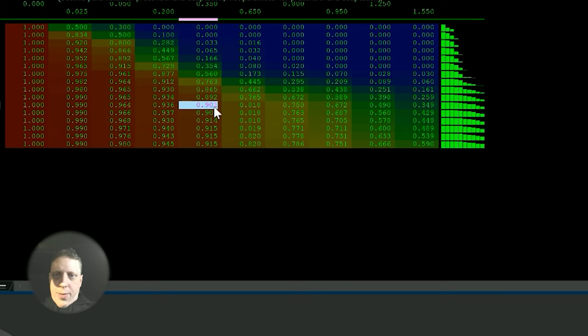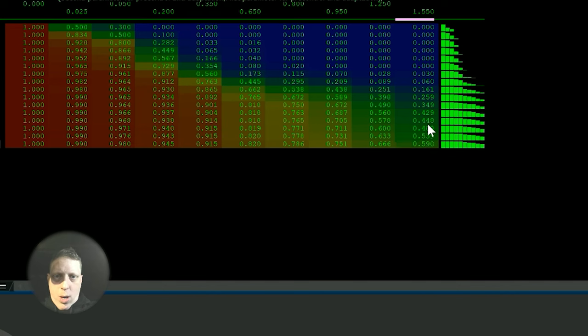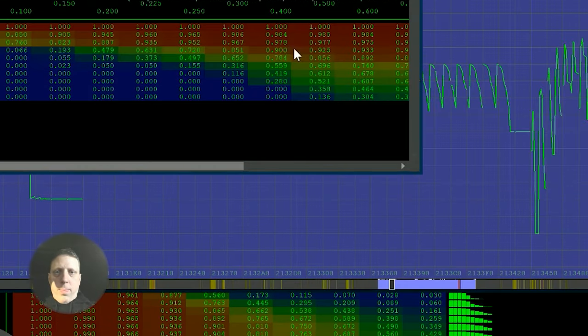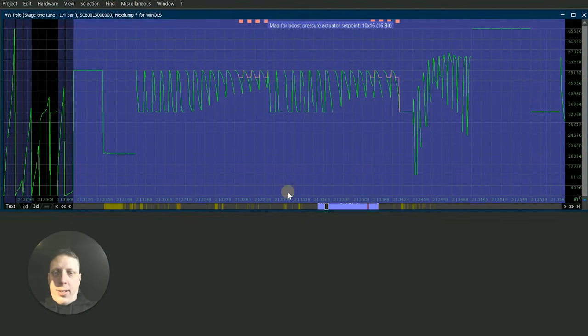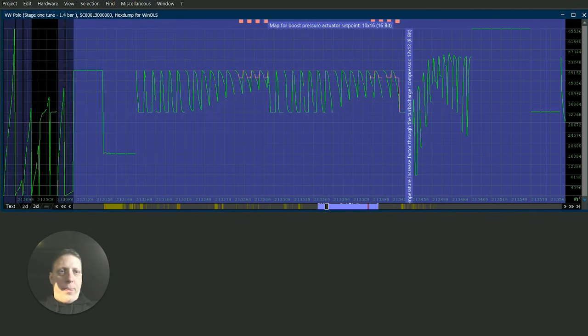So I'll do a test. Say if I... you're only really going to be using about 4 rows down. Any more than that, you don't really need. So what we'll do is I'll actually raise it, just as a test to see what it does. Will it over target or will it under target? So it's 6.5, 1.9. I'll just bang that into both. So I'm going to add more just to see how it behaves. Quick flash cards, you can mess around with them. Leave everything else as it is, because when you're looking to fix stuff, don't try and change too much stuff, because you kind of have to go back. So we're version 2 that, then we'll flash it on.